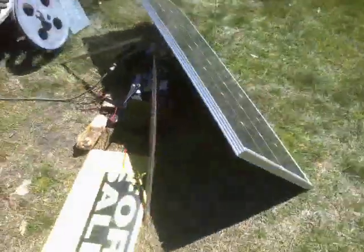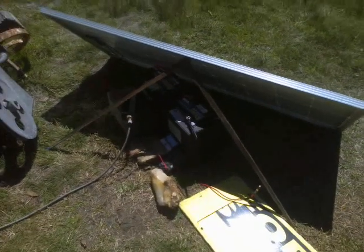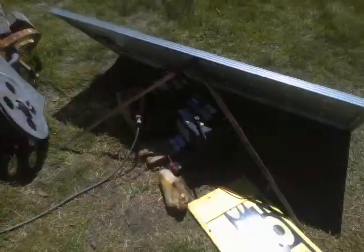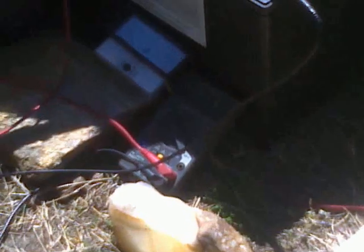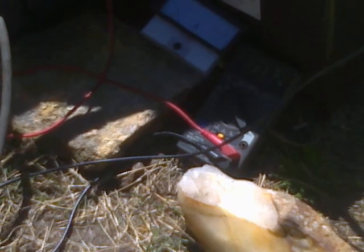As you can guess, I am still attempting to rescue those batteries. So far I've got them to the point where they'll be at 12.9 volts in the morning after a zero-degree Celsius night, and after about half an hour of 0.8 of an amp drain they'll be holding maybe 12.65 volts. So yeah, they're not dead — they're not making a Lazarus-like recovery either, but that's a different story for another day. It might only be providing half an amp at 12 volts — I'd have to interrupt proceedings to figure it out, because at the moment the amp meter is connected between the panel and the battery, not between the battery and the inverter.